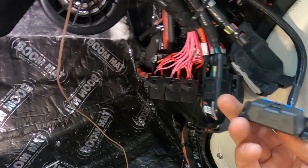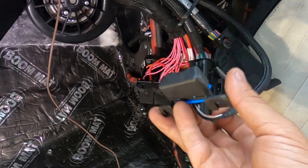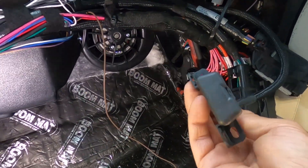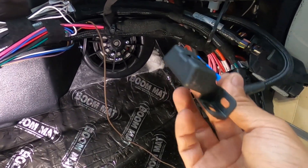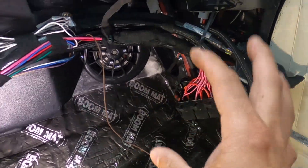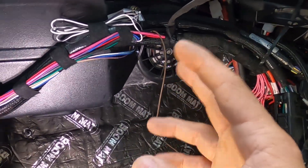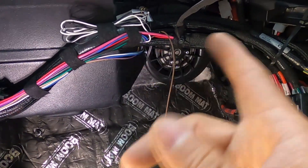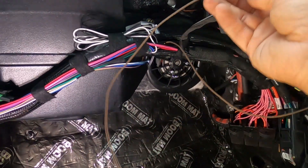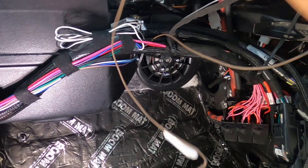You'll have your bulkhead for the ECU just laying here. We've got our OBD-2 port — we'll plug that into our OBD-2 module from Dakota Digital to give us all the readings for the dash. That really is the best way to do it; it's the cheat code. If you don't do that you'll end up having to wire individual sensors to the engine and have a lot more wires. They do give you a speedometer output and RPM output, but you'd have to calibrate those. You'll also have your check engine light wire right there — we're wiring that up to our Dakota Digital check engine light.